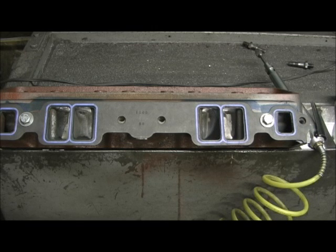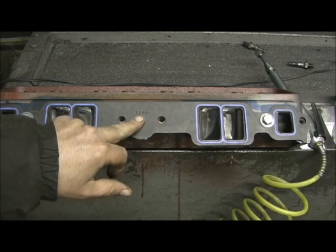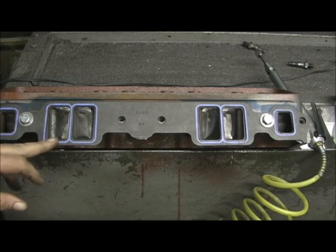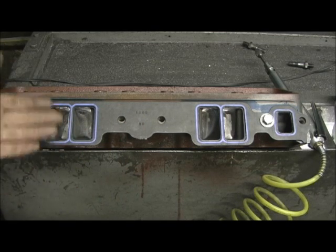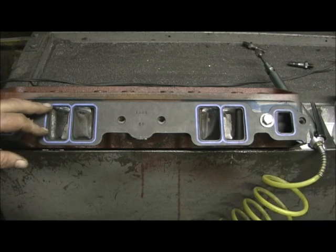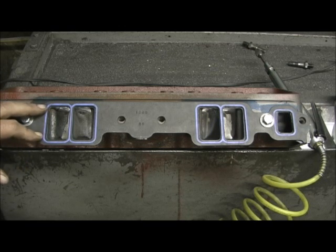That's surely the case here. I'm referring to the fact that I'm having to use a Felpro 1205 medium race port to line up with this head. There's just a little bit of meat on the inside to trim to get to the dimension. That just shows you Chevrolet's trend.